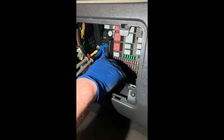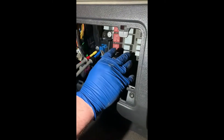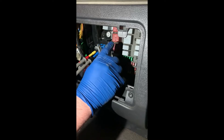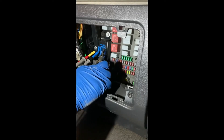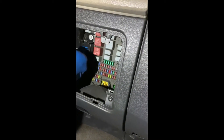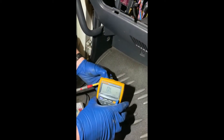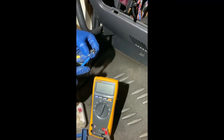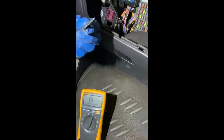What we're looking at here is we might have a resistor fault. We can have a broken wire in the loom which is not allowing us to see the resistor, or we can have a faulty module where the solder joints at the back of the board have come off and the resistor physically can't be connected to the circuit. This one here can be easily removed — using long-nose pliers, you take the resistor out. We can confirm it by placing our multimeter across the two terminals. That allows us to see that that resistor is actually okay — roughly 120 ohms. So that is a good, known resistor.